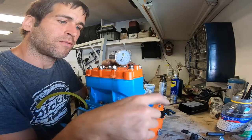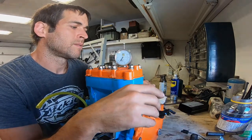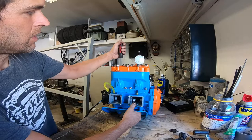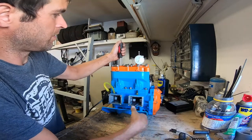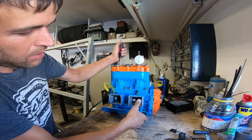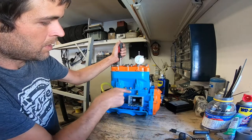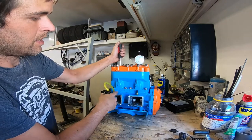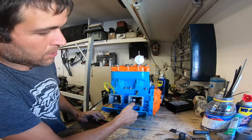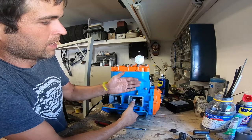This is also how you would find top dead center if you wanted to set the timing on your engine using a degree wheel. Make sure that the engine is on top dead center by doing two things: I'm pushing down on the piston on this side and I have a wrench that is in through the intake, using it as a fulcrum on the rod. I'm making sure it's at bottom dead center on this side, top dead center on this side, and then using the 10mm wrench to push up on the bottom of the big end of the rod to take up all of the play in the bearing.